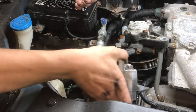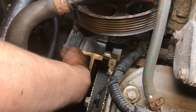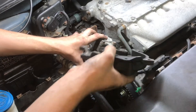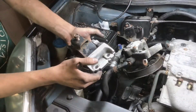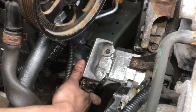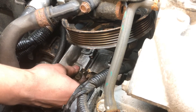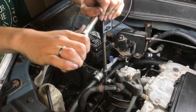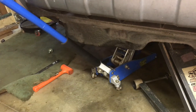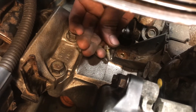Start installing the old motor mount — I like to clean up the parts before I put them back in. We'll put in the timing covers on the top. This is the second half of the motor mount — we can go ahead and put that in once we have all of our timing covers on. It's definitely tight down in here. The motor mount bolts are torqued to 33 foot-pounds, and the two top motor mount bolts are torqued to 18 foot-pounds. With the motor mount in we can remove the jack. Put in the small 10 millimeter bolt on the motor mount.